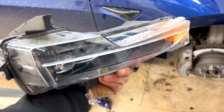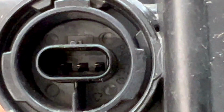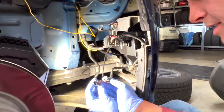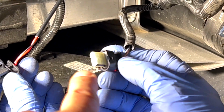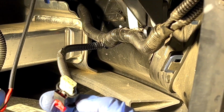Okay, for the turn signal replacement lights, obviously this plug is what you're going to be removing from your car. And you'll notice there are 3 connectors inside that are going to line up with the standard wire. And the standard wire, we've already removed it from the car. And you can see here on the right, this is the Tesla wire harness. And inside of here are 3 plug holes on the male side. So that was plugged into this, to the turn signal.